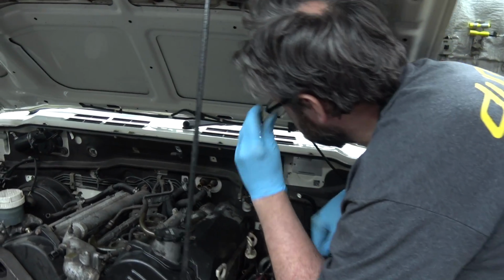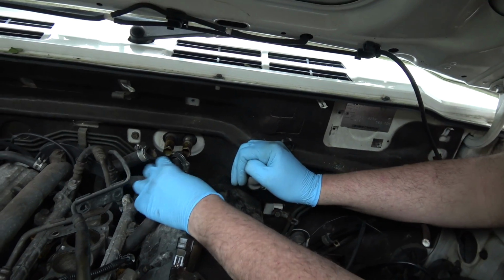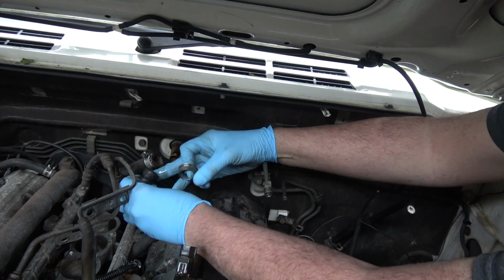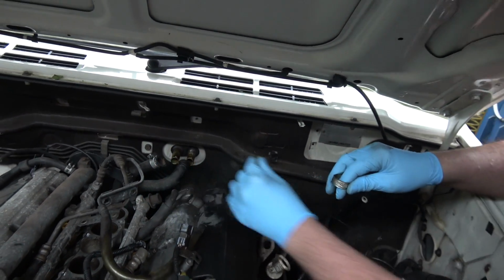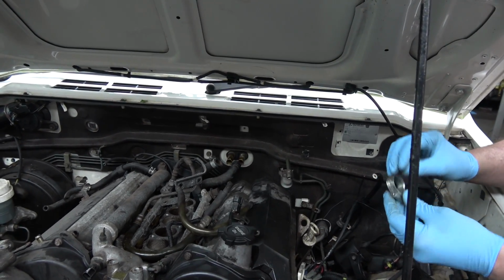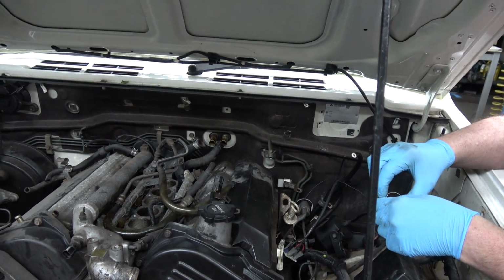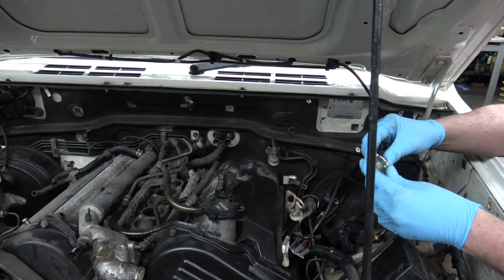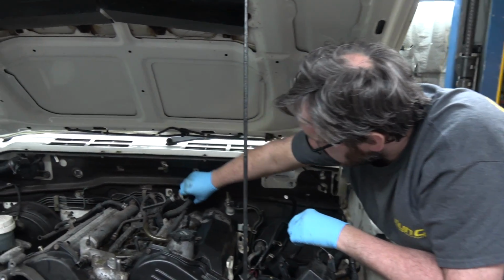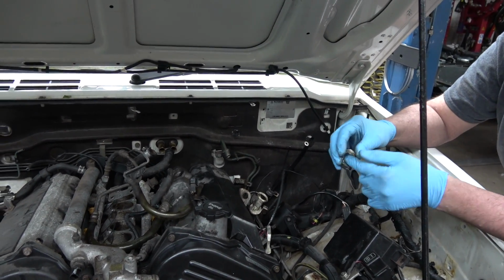And you can see what I found that blew it up. This heater hose at the back here, they'd put a clamp on that's completely the wrong size, and basically when it's done up, it squashed the hose like that. And it overheated on the motorway, and they had to get it off the motorway, and that's what's killed it, I think. Use the proper size clips. So it's obviously been leaking out and lost coolant, and then it's squashed all the brass pipe, and you can see it's been leaking water down the back, and I think that's probably why it overheated. It's a shame. Well, not for you.